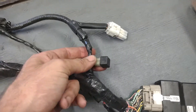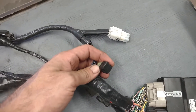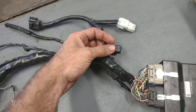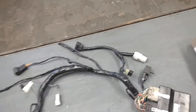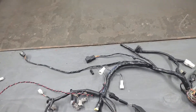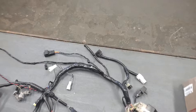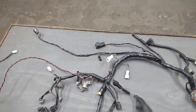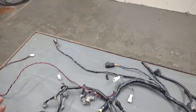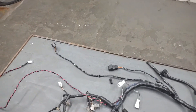This little pod here is essentially a grounding location — a junction where all these little ground wires come together, with a clip inside that connects them. It's so you can isolate individual circuits for diagnostics. It could be a problem area, especially if your car has been hit with a fire extinguisher, because fire extinguisher is extremely aggressive in terms of oxidizing wires. If your car has been hit with a fire extinguisher, you're probably going to have wiring harness problems — if not instantly, then very soon. In that event, I'd recommend pulling the harness off, cleaning everything really good, and putting dielectric grease back on all the plugs before plugging it back in.